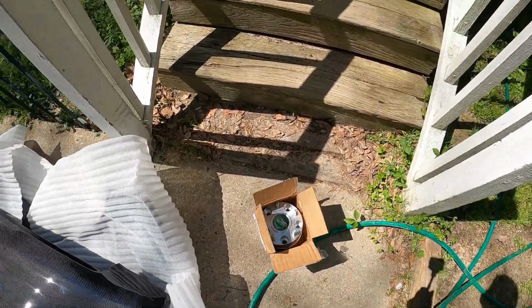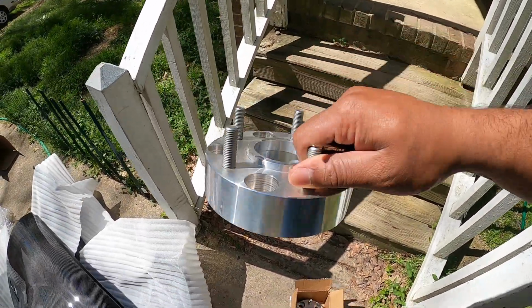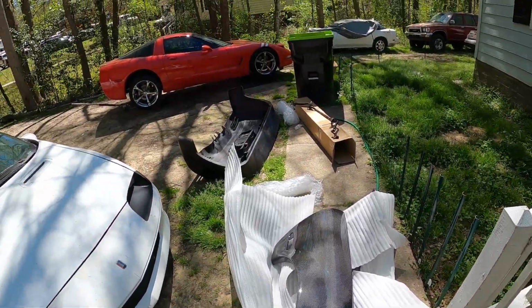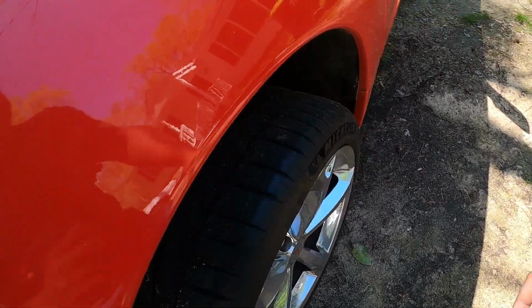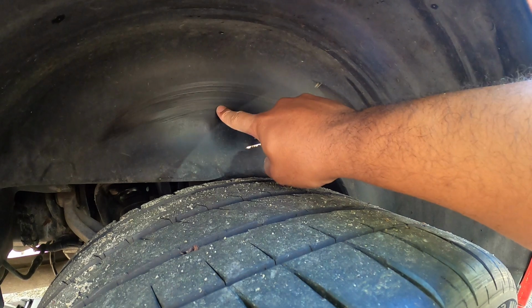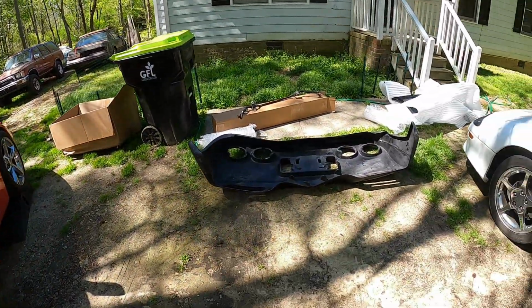And then for the fitment that I've wanted from the little bit of research I've done, I wanted 1.5 inch spacers. This is from uswheelspacers.com. And I think that they'll fit nicely with this 2-inch extension from the side of the quarter panels. And these already poke slightly, and I rub a little bit back here. Not as often. It's in drastic circumstances, like huge bumps, and very hard turns, the tire will flex over and rub a little bit, but we won't have those problems anymore.